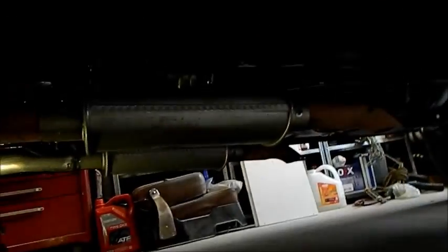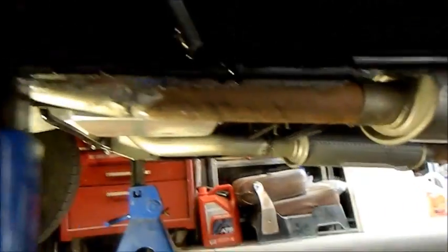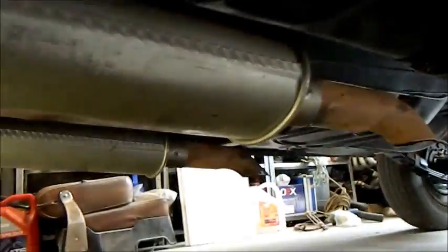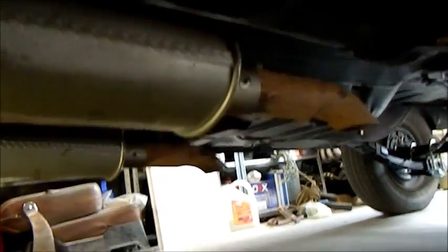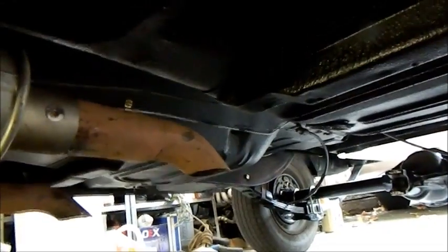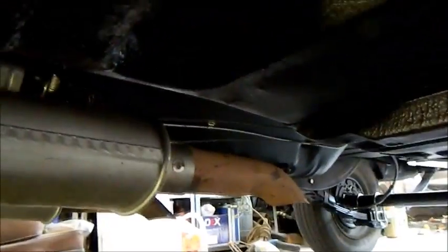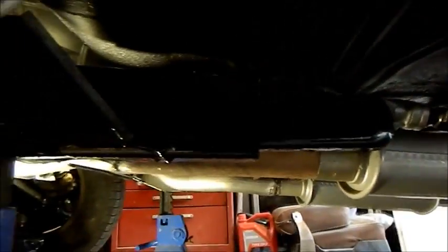The wind's up — it looks like there's going to be a bit of a storm. Have a look at this for something very dodgy — Falcon sports exhaust. This is just a very temporary thing until I get the proper dual exhaust fitted. It's made up of six-cylinder Falcon 221 engine pipe — I made those drop pipes so I don't damage the underside coating. There's a Mustang bit of engine pipe and more six-cylinder Falcon pipe. It's all just pretty tacked together poorly, but at the end of the day it'll work as a temporary measure.